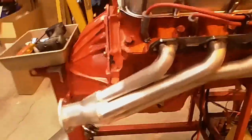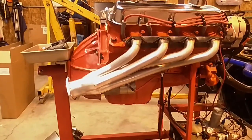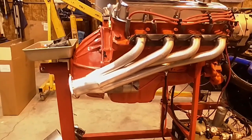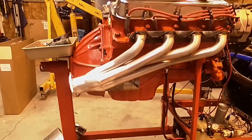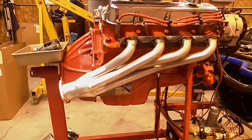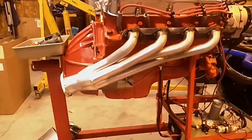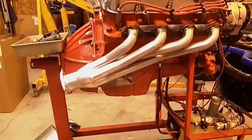I think it's going to work. I wish the angle was more like a 45. I'm going to have to figure out what the angle is so I can get a tube to match up to the rest of the exhaust. I kind of know what they were thinking when they did this — it was designed for 77 and up Cadillac, so I'm sure they were missing stuff that was in that car. My goal is going into a Chevy truck.